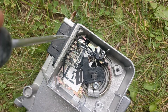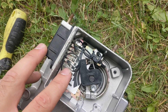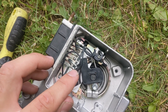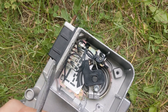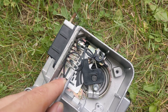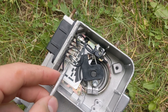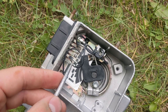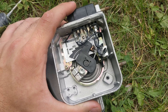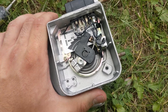I went over and did this one as well. While I was at it, I took all these sockets off, flipped them over, and looked at them. I noticed that on some of them, the wire was just at the back of the sockets where you crimp down on the insulation to hold the wire, but the insulation was not crimped down at all — the wire was just barely being held in. I went along, fixed that, put the wire back in, crimped it down the best I could, and then soldered all those pins. If you're having problems with one of these mass airflow sensors, they're incredibly simple. If you know how to do some soldering and are generally mechanically well-minded, this is a very easy thing to get in and fix.